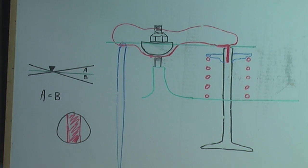When you pull your cylinder head apart for a valve grind, you'll see the wear pattern on your valve stem tip and you'll know straight away whether your rocker geometry is okay. I've never seen it go the other way where the valve stem marking is inboard, because that would mean your pushrod is very, very short. It's always been either in the centre or it's been outboard. I don't think I could explain it any better than that on this whiteboard. So we'll go back downstairs and we will finish off that cylinder head.